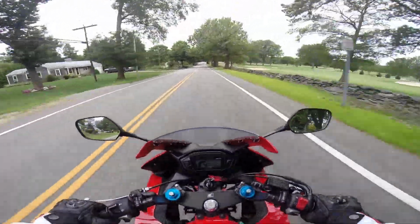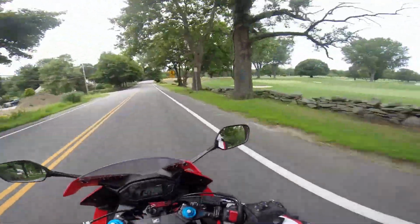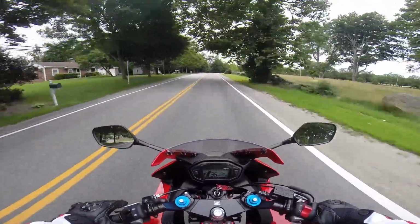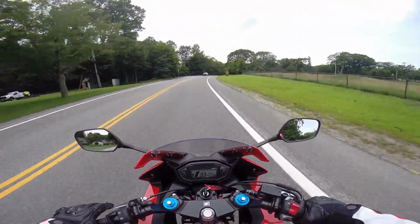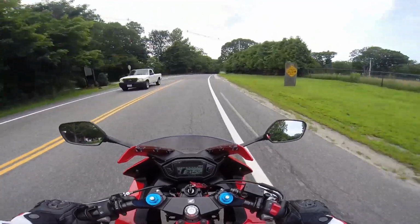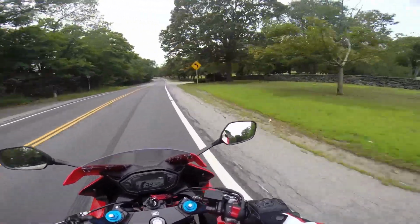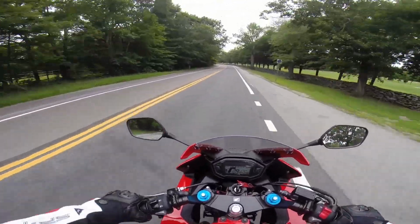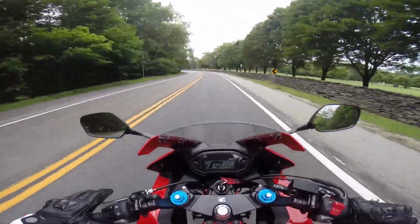So once again, I'm in 4th gear now, doing about 40, say. And I'm going into a corner, want to downshift, pulling the clutch, down on the shifter, blip the throttle, like this. Just like that, I'm in 3rd gear. Simple as that. If I want to get some engine braking going on, 2nd gear, simple. Go back up to 3rd.